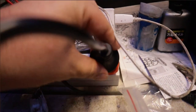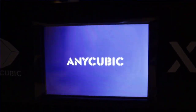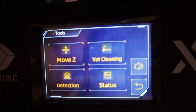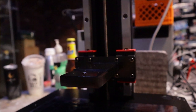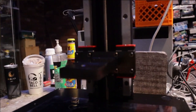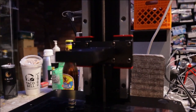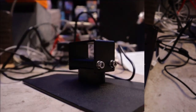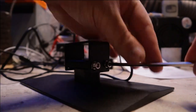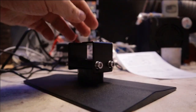Moving to setup — a very rapid and easy process. Plug in the power supply and power the printer. We are met with a menu of three options. Select tools and move Z-axis. Move the Z-axis 30 to 50mm up by pressing the 10mm increments and choosing up three to five times. Place the calibration paper onto the screen — it's about 0.2mm. With the provided Allen key, loosen the four hex nuts either side of the bed adjustable bracket.